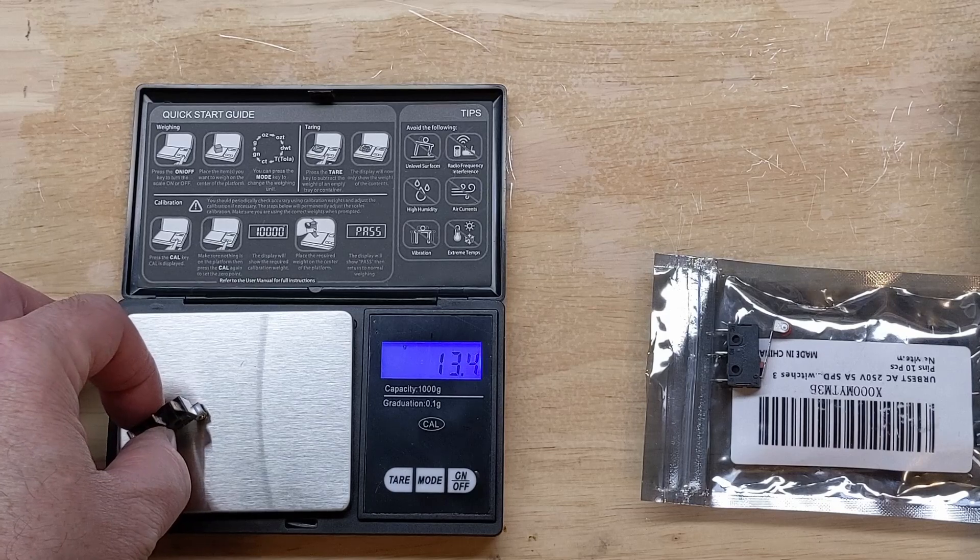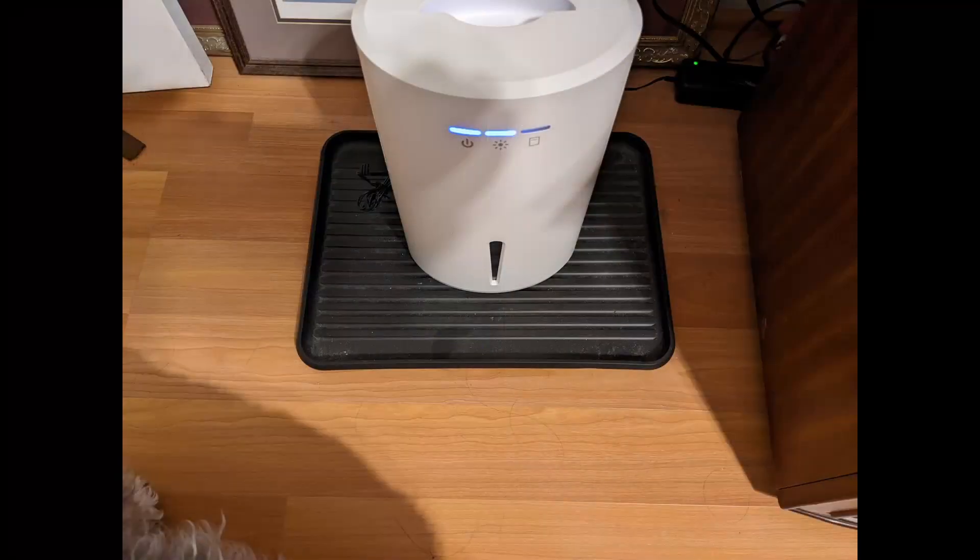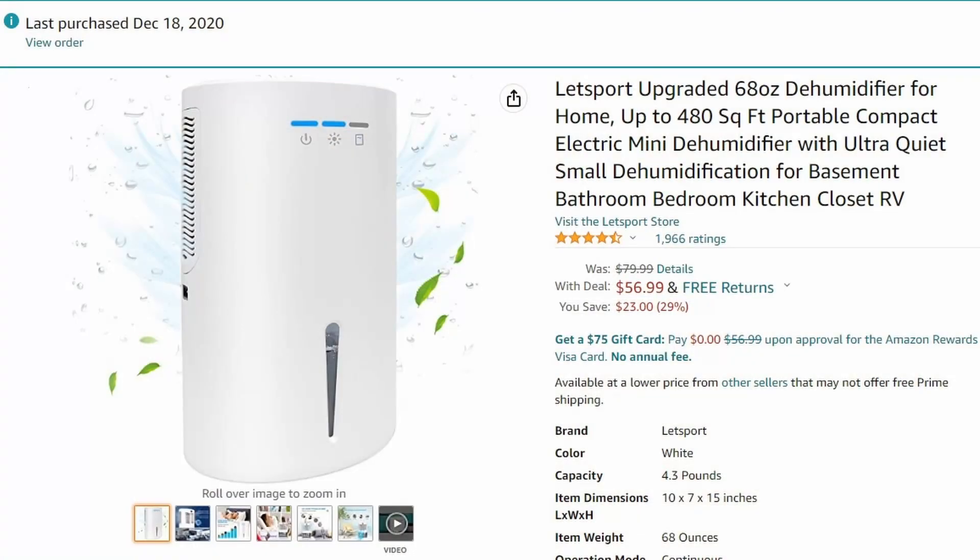I definitely recommend the Omron switches. We did get this back going, and I always keep a little tray under mine because I have had these start leaking when I put a heavier switch in there and had to calibrate the float — just something to keep in mind, especially with a hardwood floor. I hope you found this video helpful today, whether you're having issues with your mini dehumidifier or thinking about buying one. I'll have some links in the video description for the switches and maybe for these dehumidifiers for reference. Any Amazon link you click is an affiliate link and it really helps my channel. Thanks so much for watching, and God bless you.